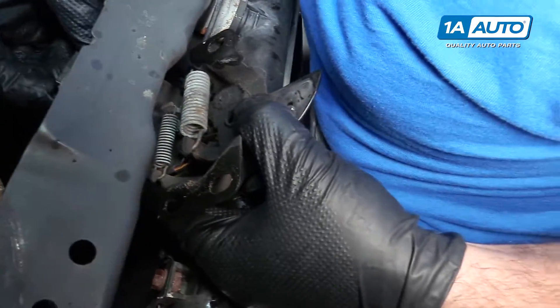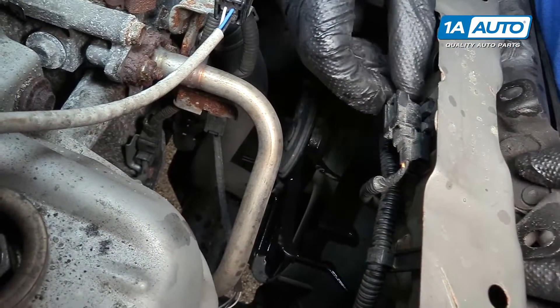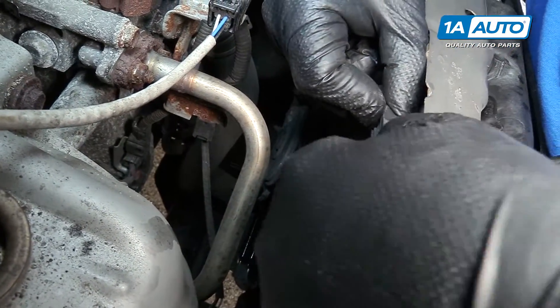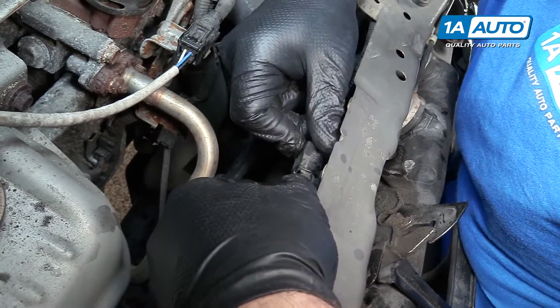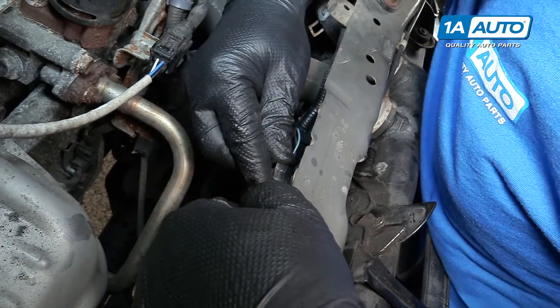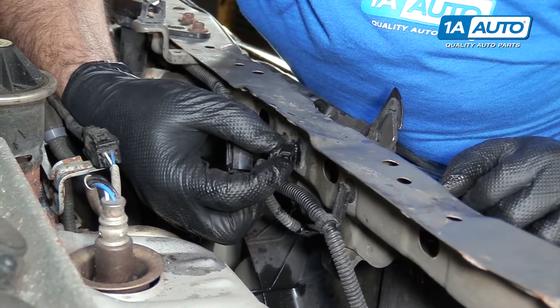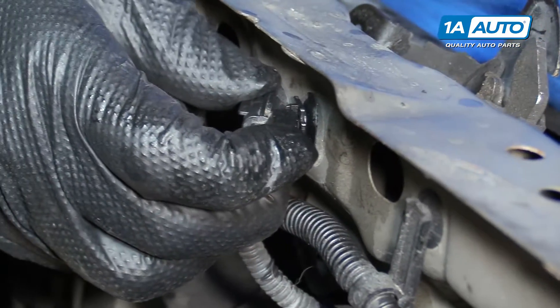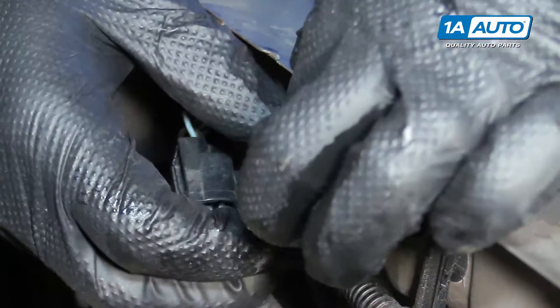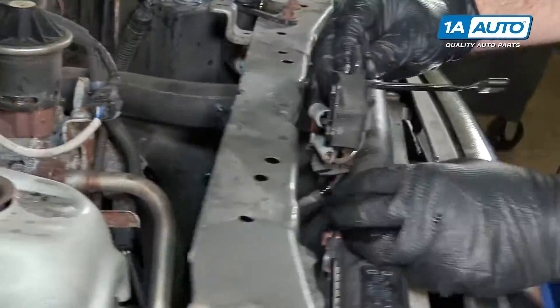Lift the latch off the radiator support to unplug it. That's the little sensor that tells you the hood's open. Plug it here and slide it off of the radiator support. This tab's got some flex to it — there's a little lock right here. You can push down, and then you might need to use two fingers to push it in, and then slide that off.